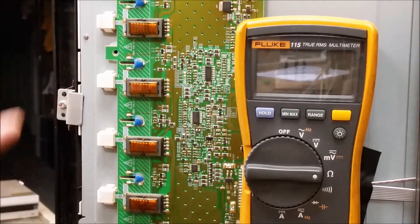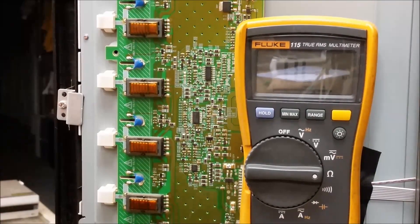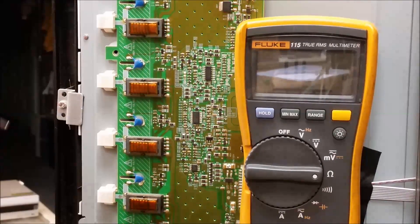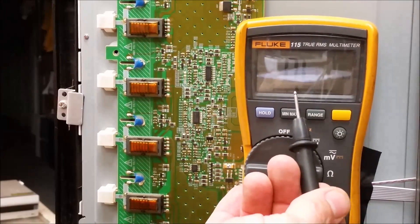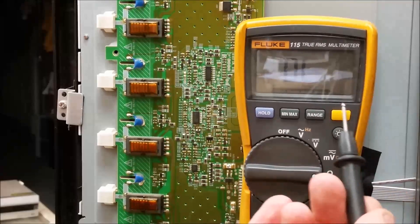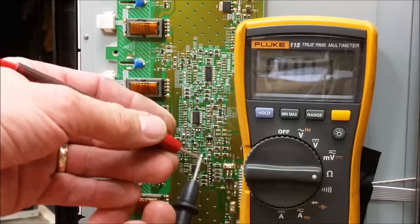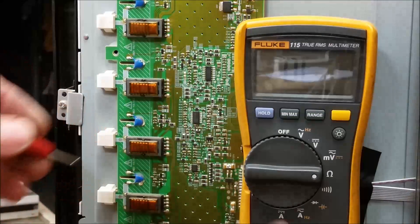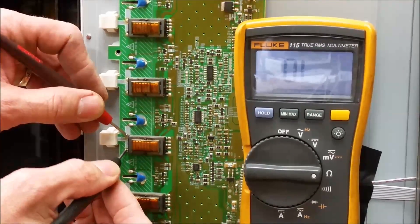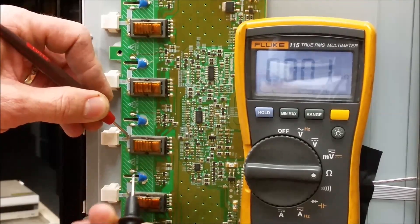I've got my meter set up on the inverter board with these transformers, and I wanted to show you real quickly how to measure them. This is specific to this exact model. With your ohmmeter in the K-ohm position — 1,000 ohms — on the sixth scale, so 6,000 ohms maximum. If I short the leads together I should see pretty close to zero ohms, and I do. These two leads on the transformer are coupled together, so you should read zero ohms across those.